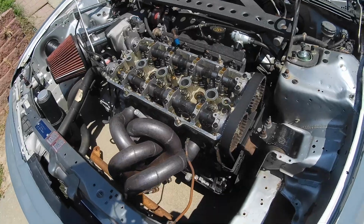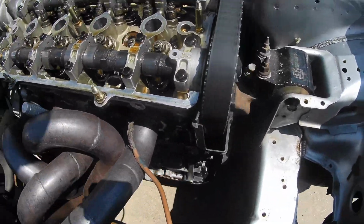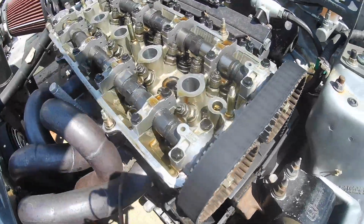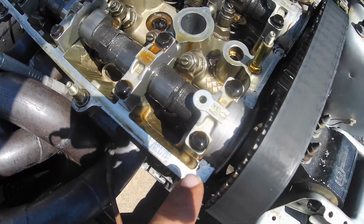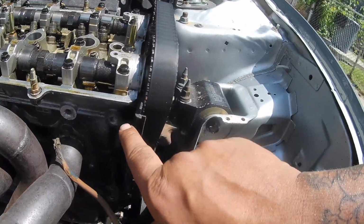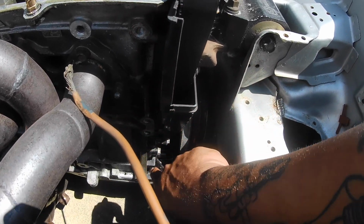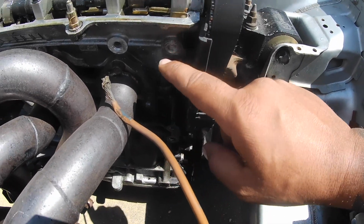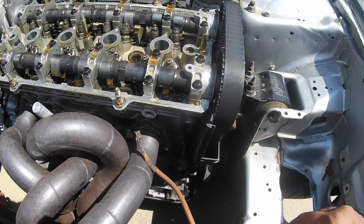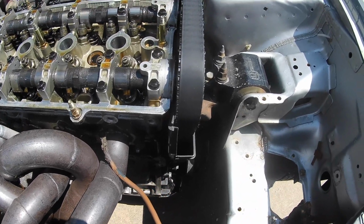Alright, so I got the valve cover and the little side timing cover pulled off, and you really can't see anything from the side because you have the back cover on. But inspecting up here, the surface here, where it looks like it's coming from, because you could kind of see it's running down right in this area here, coming straight down. That's why I thought it was the oil pump. But I sprayed all this down with brake clean yesterday, so it was nice and dry. But then I drove the car for probably like a half hour or whatever, so it's leaking pretty good.